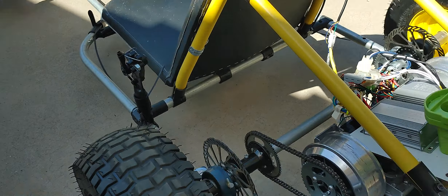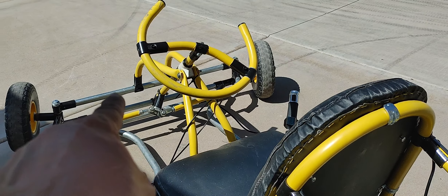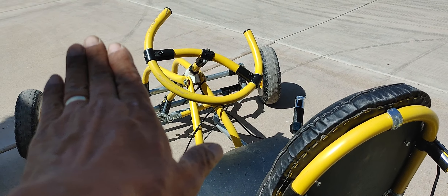Moving the seat two inches back will give me a little more leg room so my legs aren't too bow-legged when I sit with my feet on that bar. If I add a front bumper with footrests on that bar, the seat location works fine. But relocating two inches back means I have to cut these support bars two inches back. So that's one of the changes I made — and really two changes: I shortened the axle by two inches inward from each side, and I relocated the motor section four inches back.